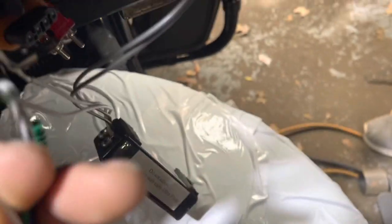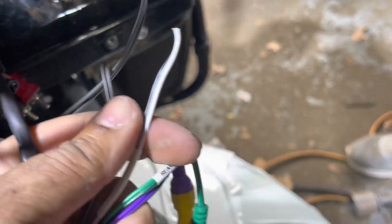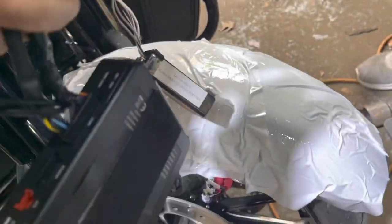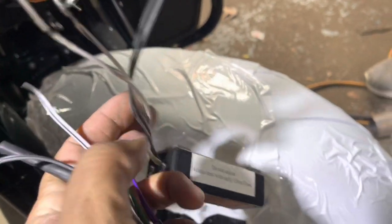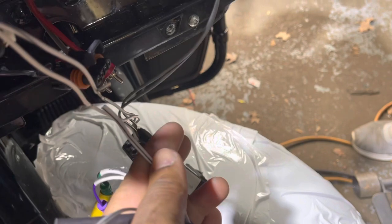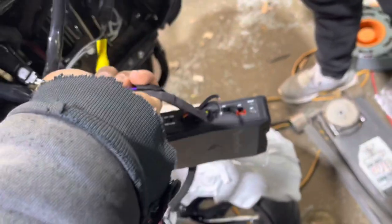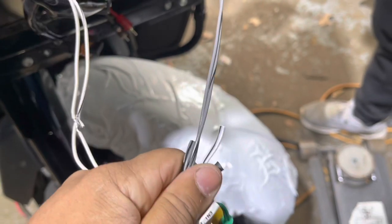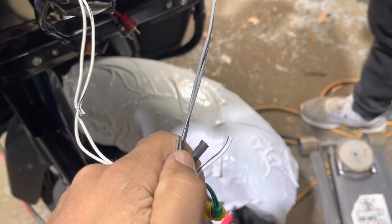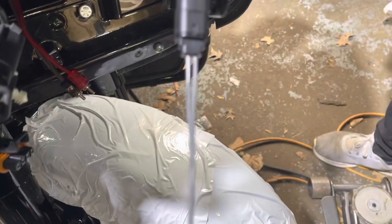So if you connect that to that and that to that and match up the colors, you now fed input from the factory plug and play harness into the DSR1 DSP. So you could have literally removed the line leveler, matched up the wire colors to the DSR1, and now made a T-harness for your DSR1 without making any mistakes, because it's color-coded from the factory. Rockford DSR1 is gray, gray, black, white, white, black. Line leveler is white, white, black, gray, gray, black.